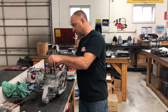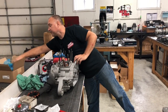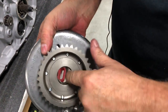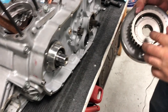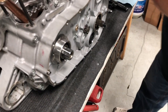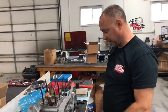Again, we put in the newer Buell XB XR crank in there. It's plug and play. You just need the motor sprocket assembly, which is right here. Just to show you, the difference is the spline pattern and the diameter. So this shaft, as you can see, has a bolt in the washer here that screws in like that to hold it. On your Sportster originally, it's going to have a nut that screws on to hold on your motor sprocket assembly.